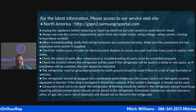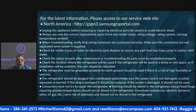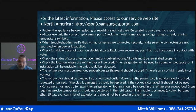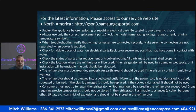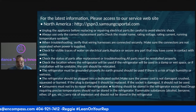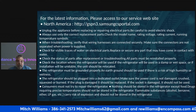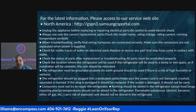The refrigerator must be properly grounded — it demands an earth ground, as shown in the wiring schematic. There won't be any use of a three-to-two plug adapter; it will cause problems with the board. The refrigerator should also be plugged into a dedicated outlet — that's been the standard for about 30 years — so that voltage spikes don't cause amp spikes that throw the breaker.